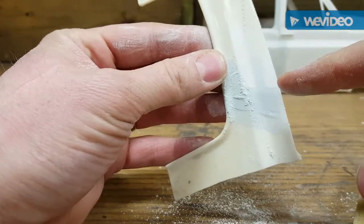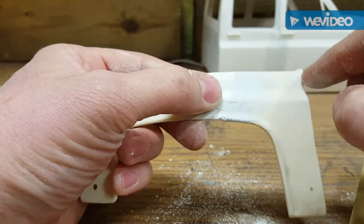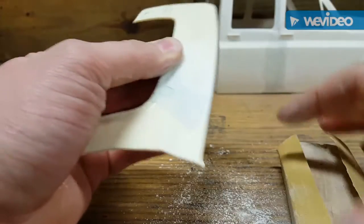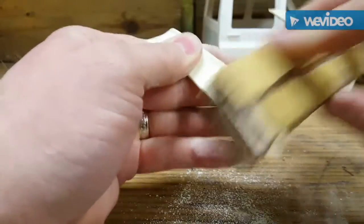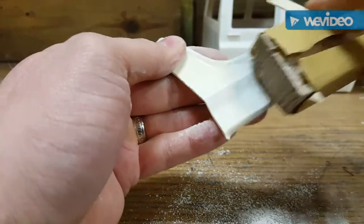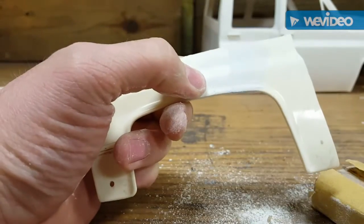As you can see here, that line right there is where this was cut. So one side of this fender, by the looks of the filler, is actually a bit lower because I'm hitting more here and here. So this will leave this part filled, and when it's said and done, it'll actually come out smooth. I'll finish sanding this and come back to it.